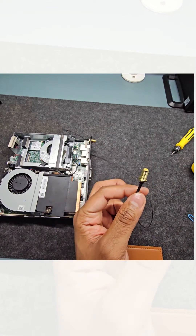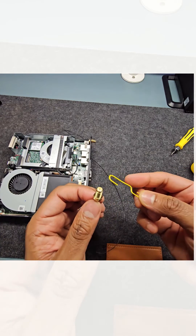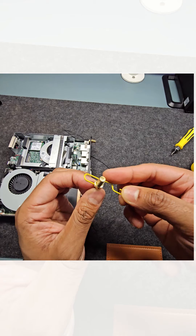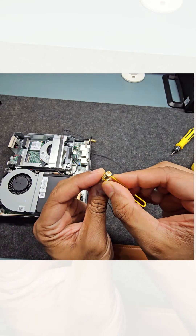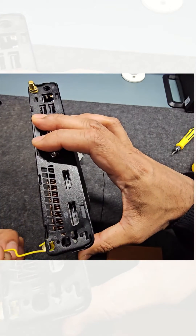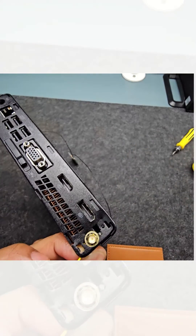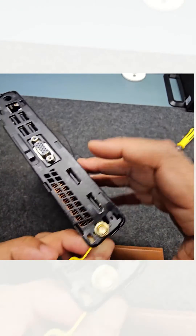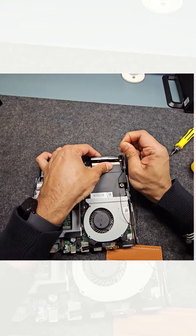Now grab the longer one amongst the two antenna holders, put one washer on, grab the guiding tool, and put the antenna holder in between. Make sure the flat side is facing the right way and press the sides for a tight grip. Put the machine in upright position, then feed the antenna holder through. Put the other washer on, then tighten the nut, but not all the way yet. Now put the machine down and pull out the guiding tool with a bit of force.